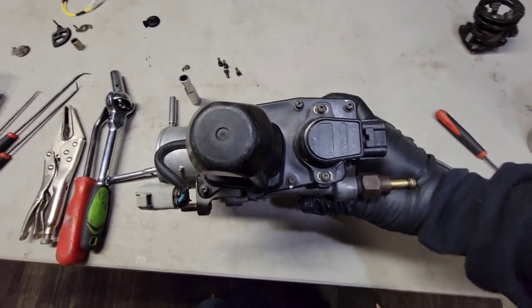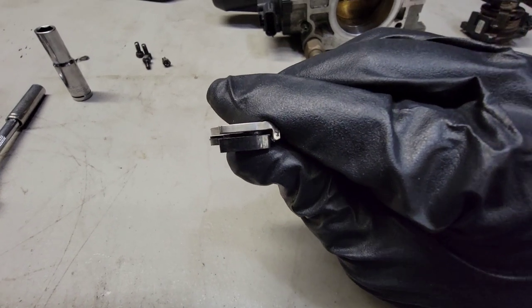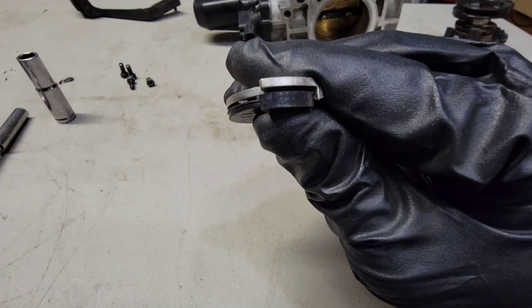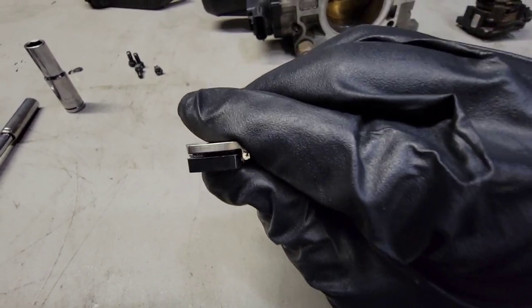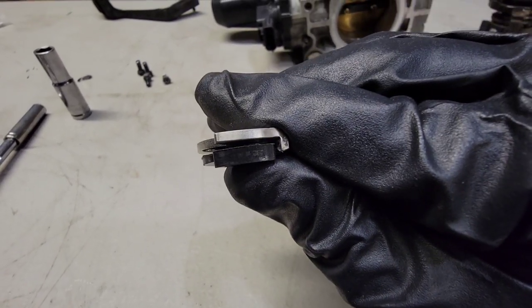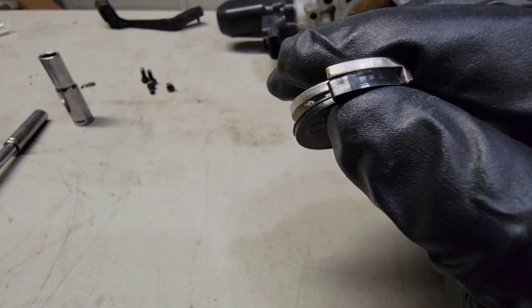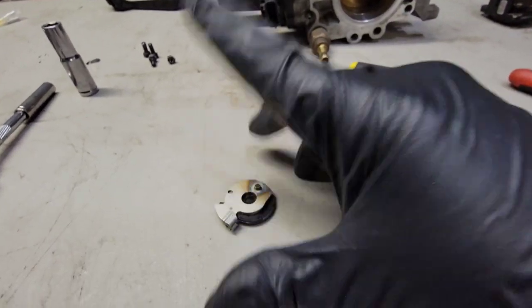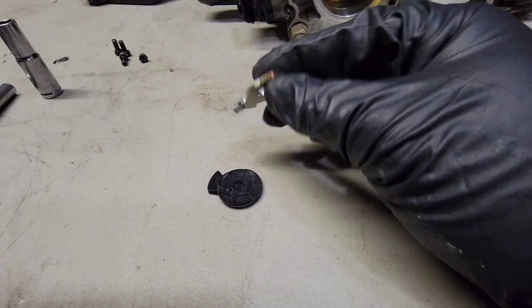Let's work on the APPS side. So I'm going to try my best to show you why I wasn't able to use the metal piece that's on top versus the throttle lock. Here you can see they should be the same exact measurements, but you can see that the Premium Japan piece is that entire metal piece hung over longer in this dimension than this plastic piece. They basically line up right there. And on this end, it's too long. So it was holding the throttle open when I installed the APPS sensor. So this is no good for me.